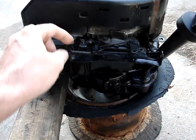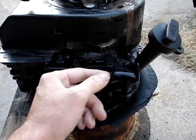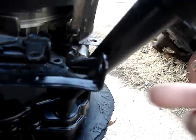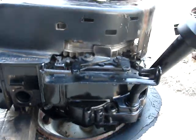This is a retaining spring that the previous owner put on this engine to hold the brake back. For a kill stop, I'm going to put a bar through here that hooks onto this, so I can have a manual push stop that will engage the brake and kill it. That way I don't have to put a toggle switch or anything fancy on it.